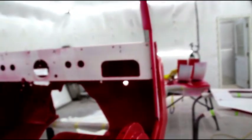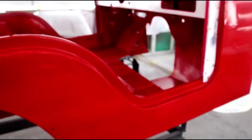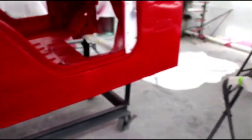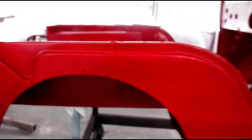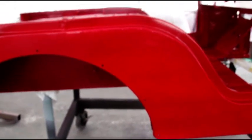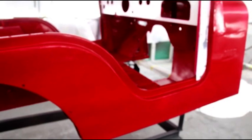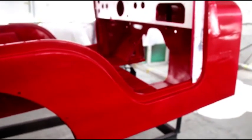I've got to get a lot of stuff put together, and we got to do a little bit of sanding to get some trash out of the base coat. I already sanded the inner wheelhouse there with 800 grit. We're going to go around the body and take care of any problems with some 800 grit. But I won't do that until I'm ready to shoot the base. Maybe tomorrow, maybe Sunday. Sunday's supposed to be pretty nice. I'm not sure. But we'll keep after it.